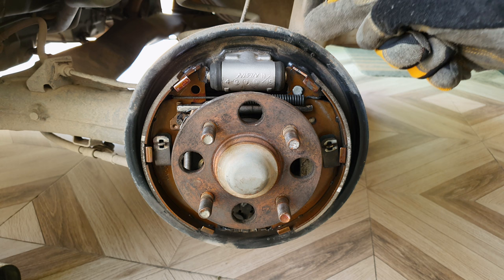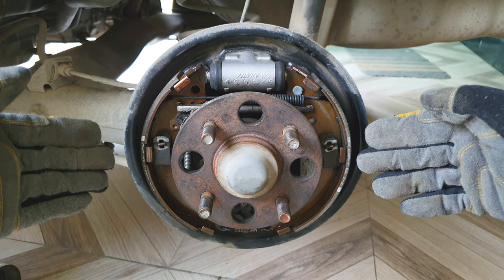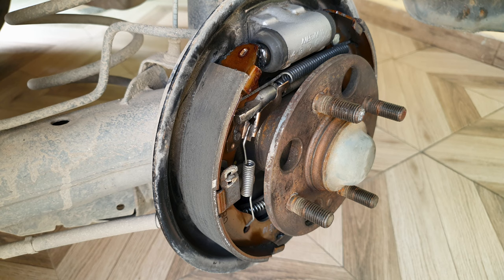How do drum brakes work? Brake fluid enters the slave cylinder when you push the brake pedal; the fluid pushes two pistons outward, and the brake shoe then presses against the drum. If the drum isn't round or smooth enough it can cause noise or braking issues. I had already sprayed this down with brake cleaner off camera but didn't use too much.